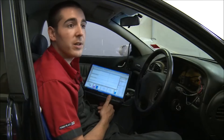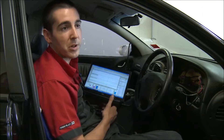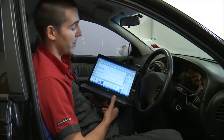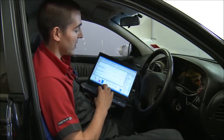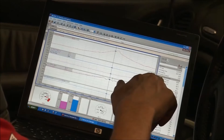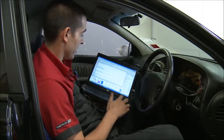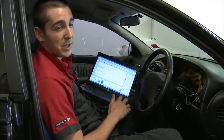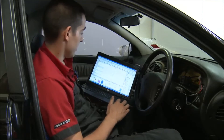We've just done the first shakedown run — just ran it off the actuator, so no boost control, and it made 950 horsepower with no dry ice. The first thing we do after we run up a car like this is check the data. The good thing about this car is it's got an M800 Motec computer, which Marty wired in pre-Summernats last year, and it's got everything in the engine you could want to monitor — RPM, fuel pressure, oil pressure, oil temperature, throttle position. After the run we go through it, check the lambda from bank to bank, boost pressure, intake temperature, make sure everything is as it should be. If everything's good, we'll add more boost and put dry ice in it to make more power.